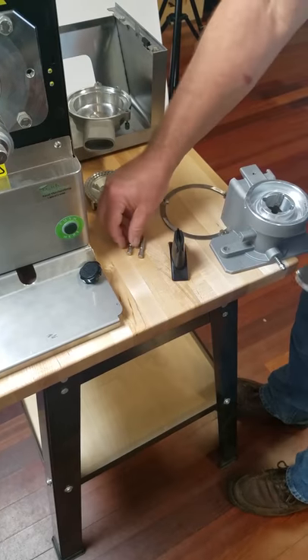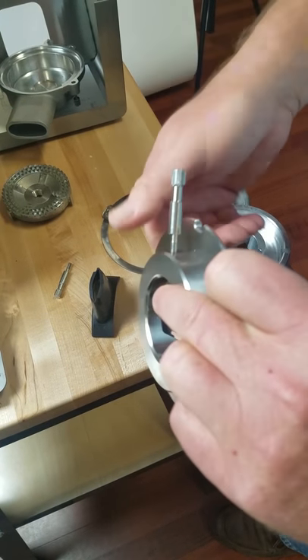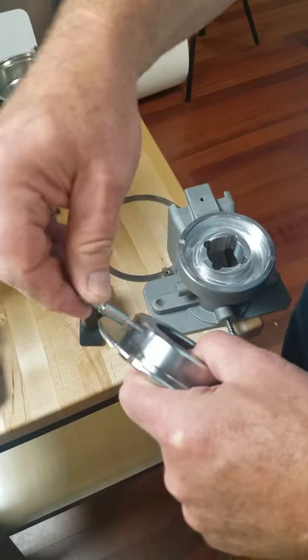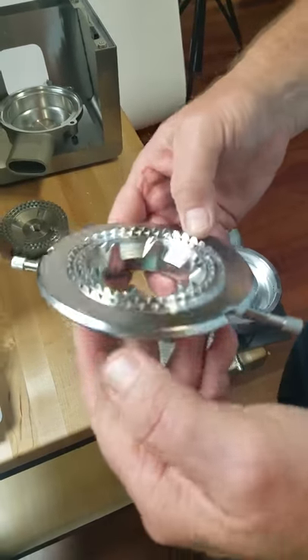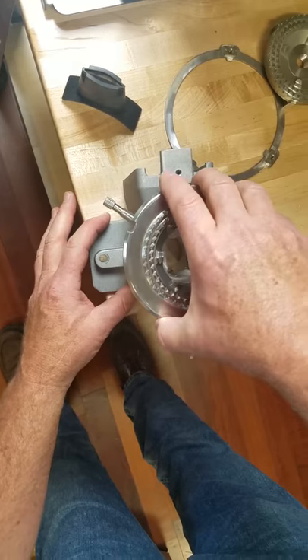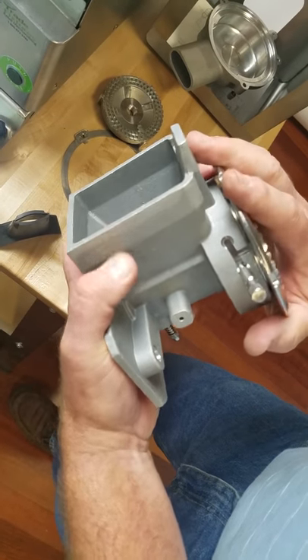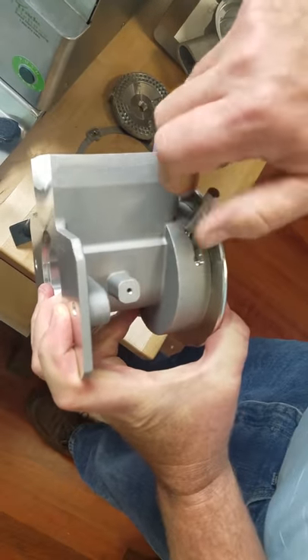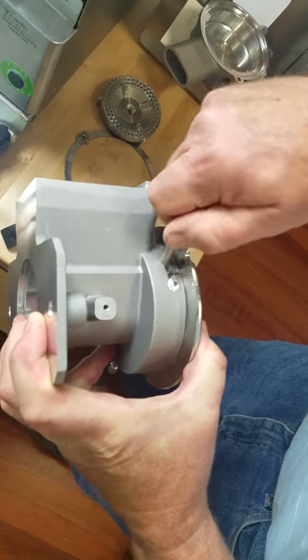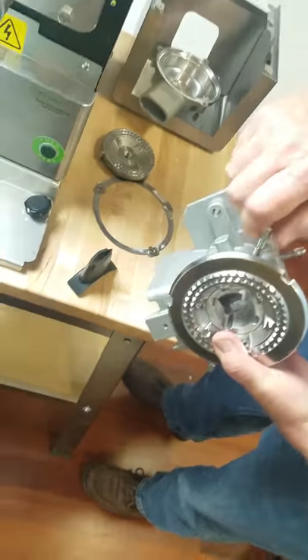We're back from cleaning — everything's new and shiny, looking good. This is the rear grinding plate. We're going to just start these thumb screws just a little bit. From previous videos, we had this little V up here on top, and that V goes to the top of the unit. Line the threads up with these slots. Now whether we want it to be coarse or fine — there's your coarse setting and there's your fine setting. We're going to start with our nut butter grinder on coarse. Make sure it goes all the way in, finger tight. Same on the other side — all the way in, finger tight.